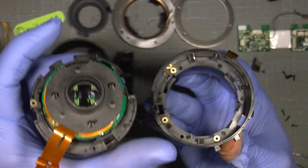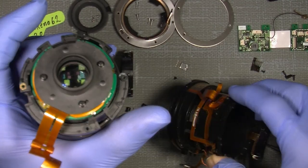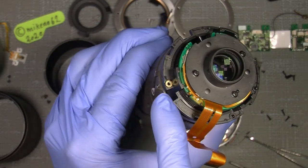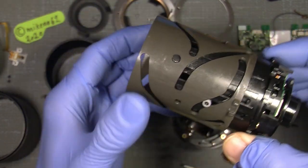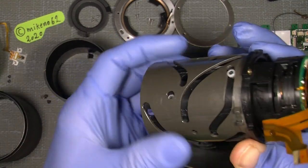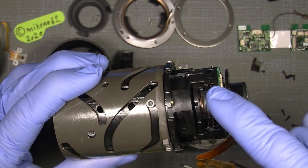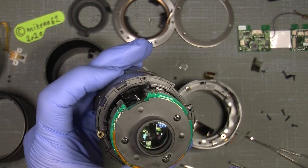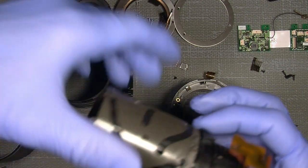As you probably can see here, there are three spacers here, and there's one here. It was just because when I was in it earlier, I simply glued, with some black nail polish, the spacers in so they would stick there. Now, the next thing is, here you can see the back of the lens group and the VR section and the aperture section in here, and I need to go in there because there's also fungus in it. Not good, but I think I will make it.